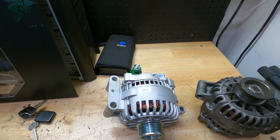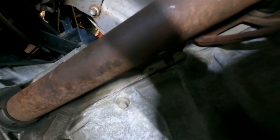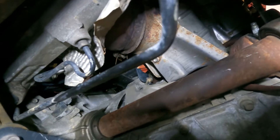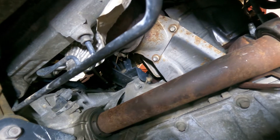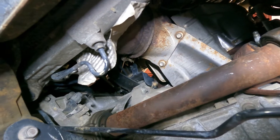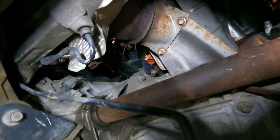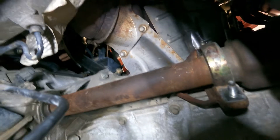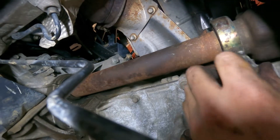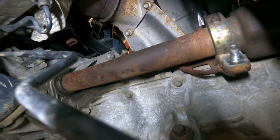Let me go ahead and show you a little better with the lighting. This bracket right up here is loose and that actually allowed me to wedge it out. There's also this breather tube for the rack and pinion — just slide it out, it's metal so be careful with it. That made sure it wasn't in the way when I popped things out, and you can tuck it somewhere out of the way so you don't break it. Now putting the alternator in is just going to be a matter of wedging and squeezing it in — loosening that metal bracket gives a little more wiggle room.